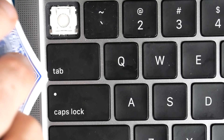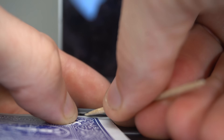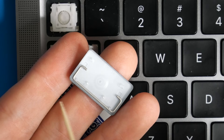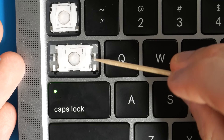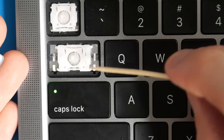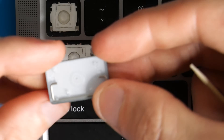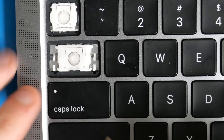The two lobster clips are on the bottom of the key and clip onto the middle of the key switch; the awning clips are at the top and slide over the two nubs there. The Tab key is a little different: go corner to corner with the card, put pressure on the top, get your toothpick underneath, and pry up the two clips at the middle-bottom of the key, then pull the key down and take it off. This key has a support bar on the bottom that rests into aluminum hooks — don't damage or move those. If the support bar comes off, just orient the key, grab the support bar, and press it back in.